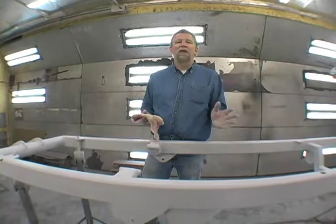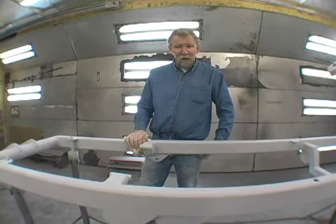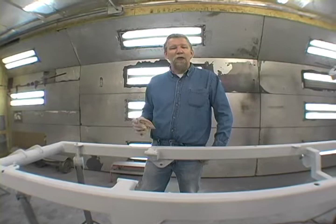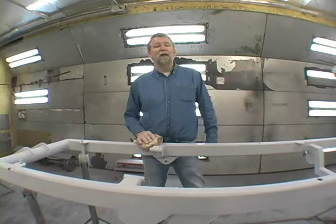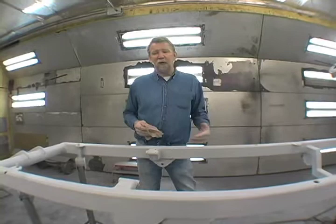Different manufacturers will tell you slightly different things there. A lot of it is just experience. What makes a good painter is figuring out your problems quickly and dealing with them chemically sometimes. A good paint gun is very important. Without a good paint gun, you just can't lay out a good paint job. So preparation: know your materials, know the flash times, know what your base is going to be and where you want to go, and how to finish it with a good clear.